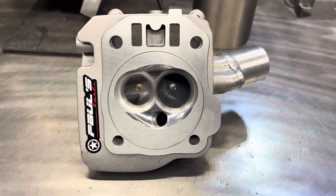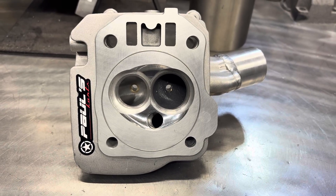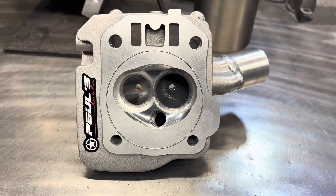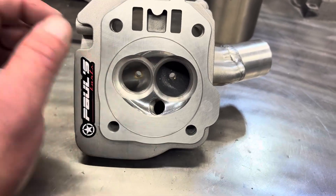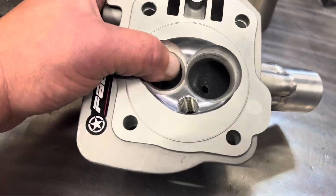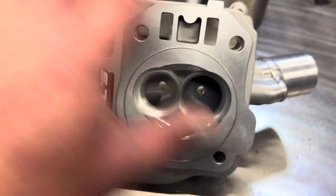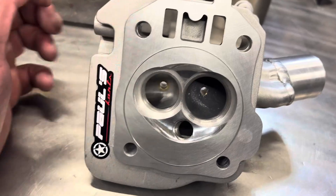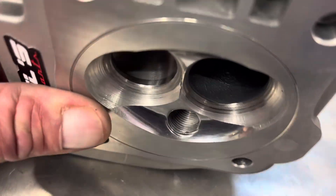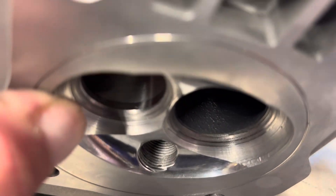So this is a look at one of my cylinder heads done for a 3-inch stroker, 266cc. Some of the options: multi-angle seat cuts, bronze guides, big valves, big seats, non-intersecting seats, radius cut chamber, milled O-rings, welded intake tube, epoxy port, custom guide, spring pockets cut, polished. And I mean, this polishing is next-level polishing — it's pretty shiny in there. Also max ported.